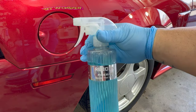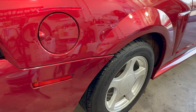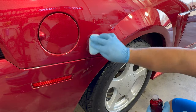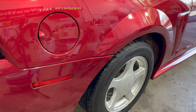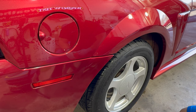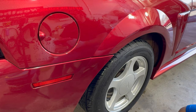That means we need to bust out the panel prep — Fireball Reborn. We tend to stay in the family of panel preps when applying a certain brand of coating, so it's Fireball to Fireball. The coating originally installed was Fireball Scylla, which is a five-year coating. We shake it up, apply a little to a microfiber applicator, make an X, box it, fill it in, and then it's a waiting game — we're watching for the coating to become slightly grabby before wiping.